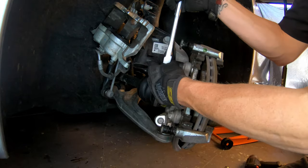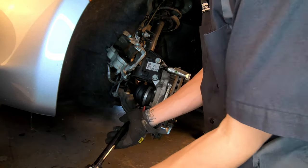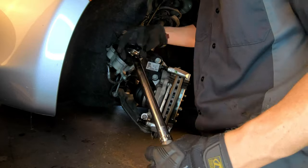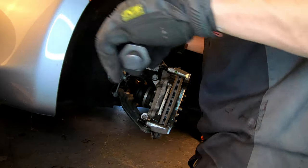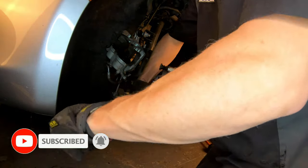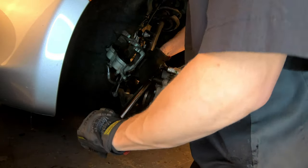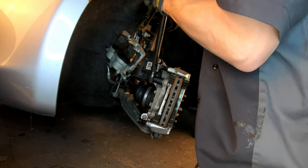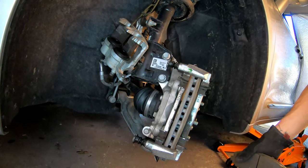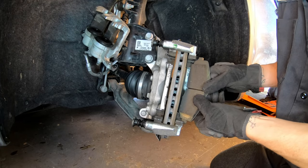I torqued this one down to 150 foot-pounds. If I get a confirmed torque spec and bolt size, I'll put that in the description below. Using my half-inch torque wrench at 150 foot-pounds — most people go to the first click, but given how tight this bolt is I did two clicks. When I get to the caliper I'll just go to one click. If you need any tools or parts shown in the video, look for links in the description below.